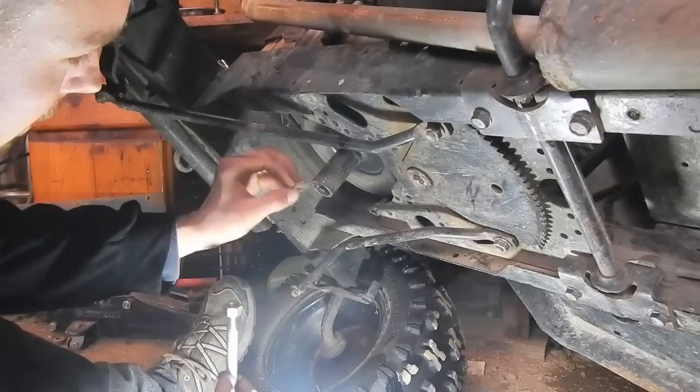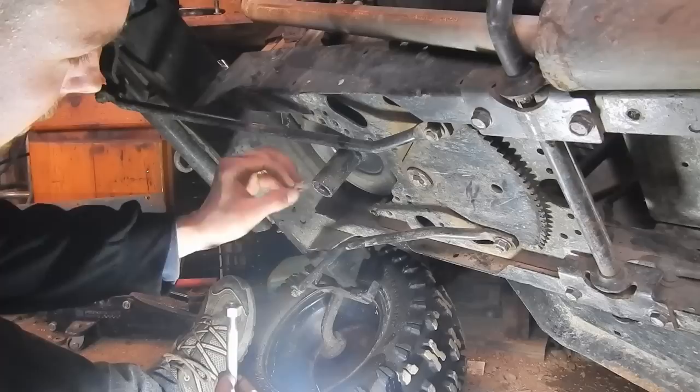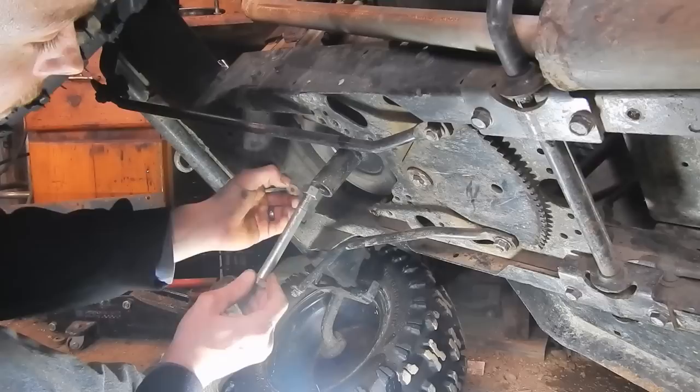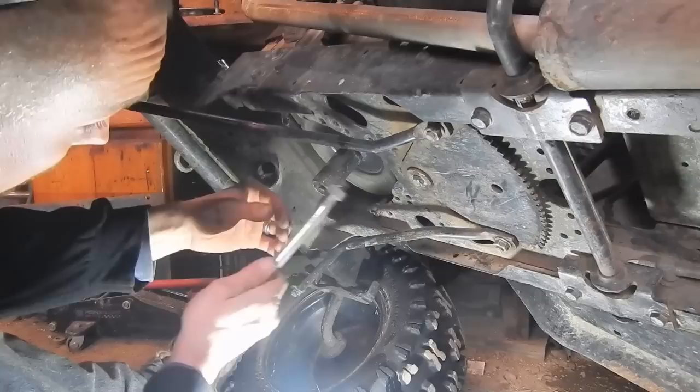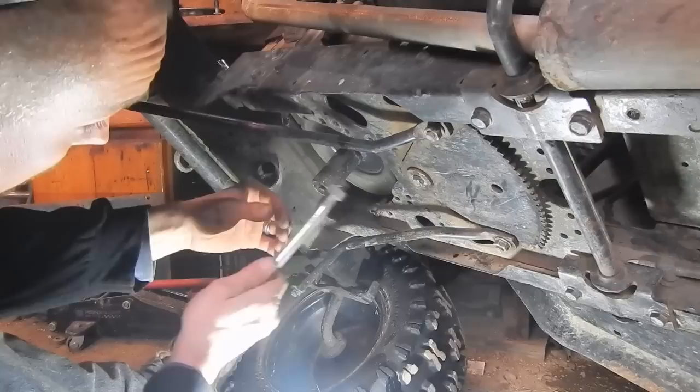What I'm going to do is slip a little washer in here to protect the end of the engine shaft and the threads, and then take this large nut and bolt and weld the nut right into the outside edge of this pulley tube. If this is welded to the pulley, as I screw this in, it should effectively draw the pulley off of the shaft. That's the plan.